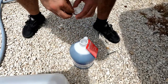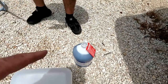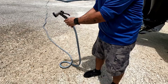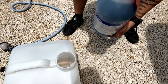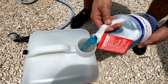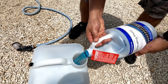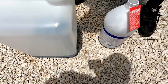We're opening up the solution — keep in mind it's acid-based, so you don't want to leave any on your hands. Open the plug and wash your hands immediately. First, we pour the whole gallon of fluid into the tank. Once the jug is empty, we'll use it as a measuring container for the water — we need four of those filled with water added to the tank as well. One gallon of chemical is now inside the tank.